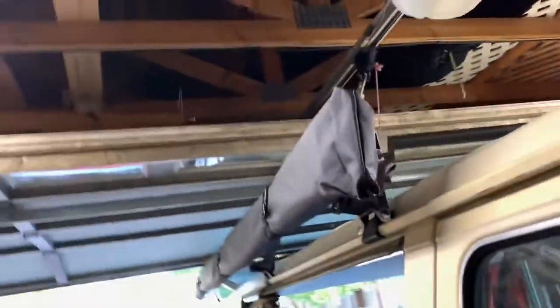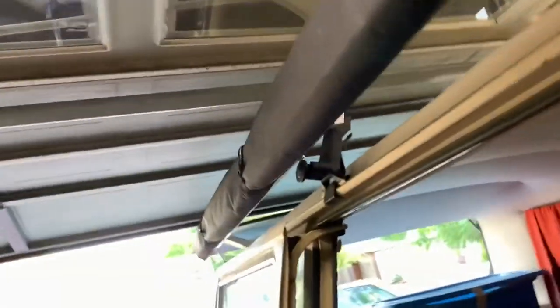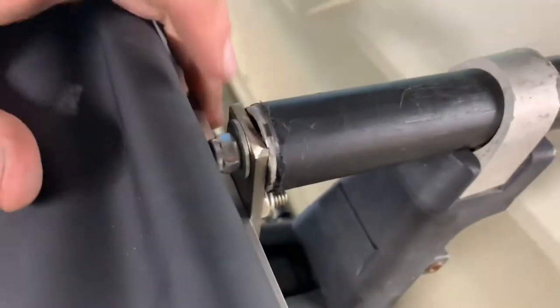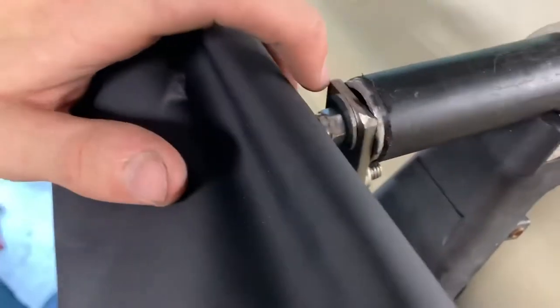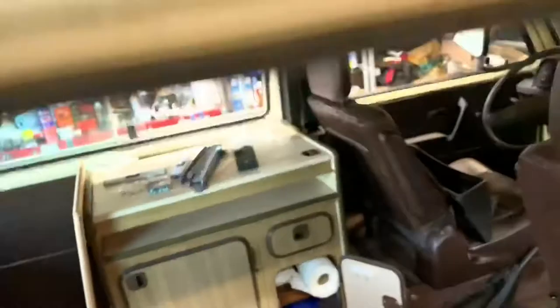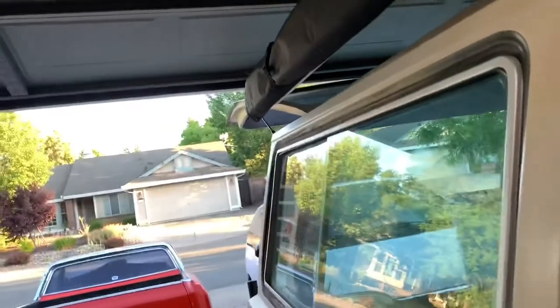Everything is complete. We got our brackets cut, and what we made with the rubber bump stop is inside here, clearly holding. We made a plate with a hole on top and two slots for the slider. The stainless hardware came with the Yescom awning — none of my drill bits could cut it, it's really strong, so we took it to a machine shop and Adam cut it for us.